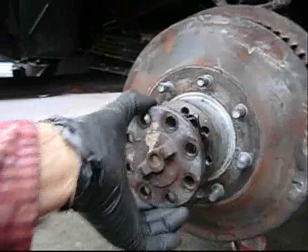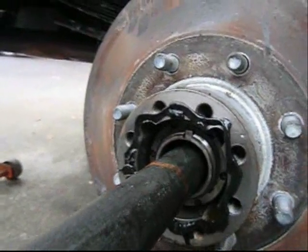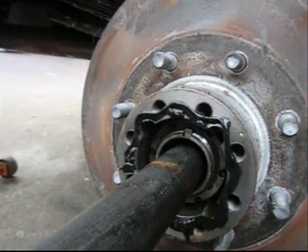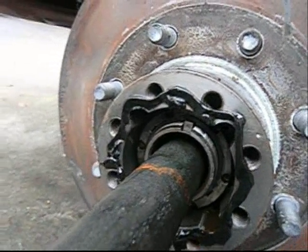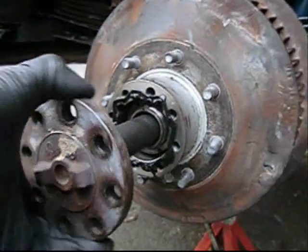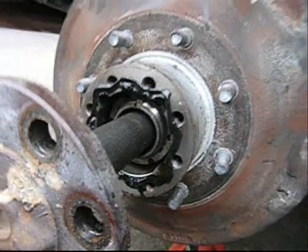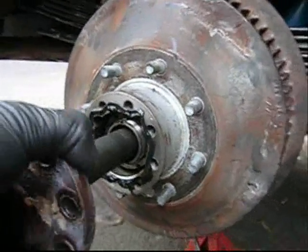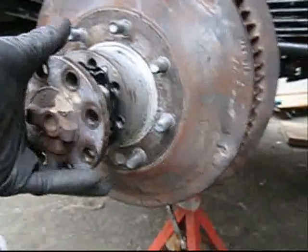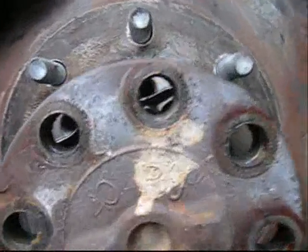All right. Things are coming together. Alright, the axle shaft. Everything's in place. My loose Woodruff key. I can't believe nothing holds that Woodruff key but the lightest tension on that ring. Anyhow, I got some silicone on the inner circumference to keep the grease from going through the bolt holes and filling my center cap up with differential lube. In goes the axle. And then you line up the drum a little bit.